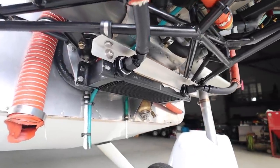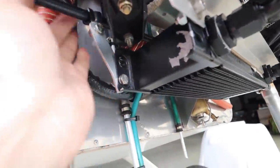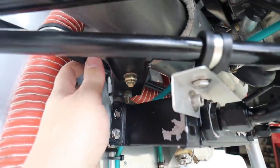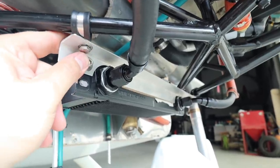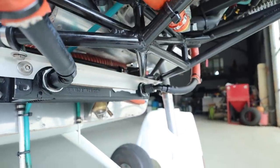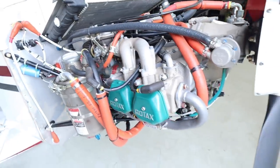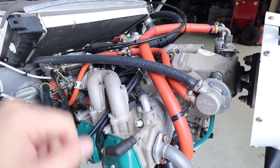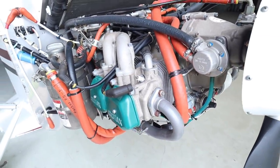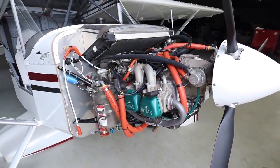That's the oil cooler fully secured. We've put a new bar in place here — you can see we used some lined clamps to put our bar in here, a couple pieces of aluminum off that with some more lined clamps down to the oil cooler. Of course the front mount we had before. This thing is really solidly mounted. We've tightened down all the fittings. Next we're going to put some oil in it, pull the spark plugs off, and disable the ignition module so we don't have any spark, shut down the fuel, and spin it over until we have oil pressure. Once we've got oil pressure, go ahead and hook that all up and start it up.